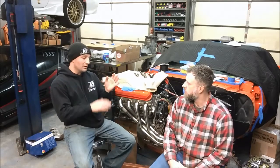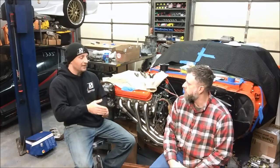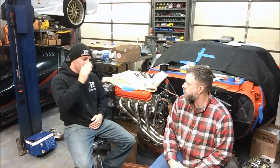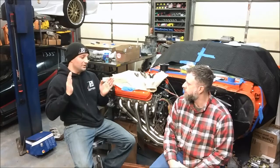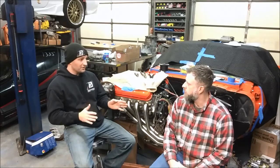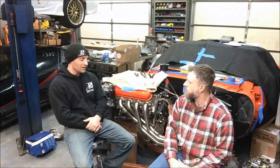Those were used — even though the computer part numbers changed — and in 1999 they standardized the pinout. From 1999 to roughly 2002, GM used that on the trucks, the Corvette, the Camaro, and the Firebird. The most popular of those controllers is what we call the 411 controller — it's the last three numbers of the service number. Those controllers are capable of running drive-by cable or drive-by wire; it can do both.